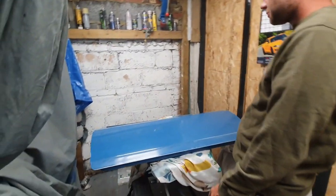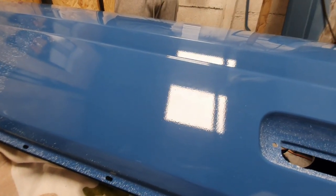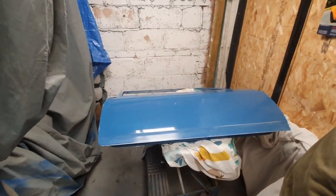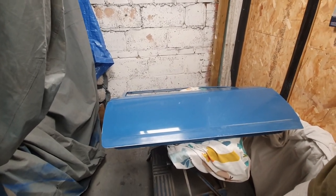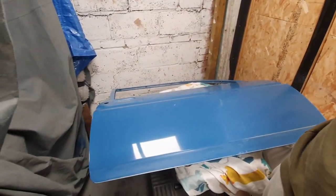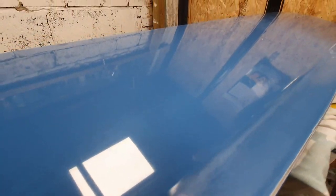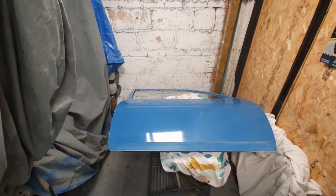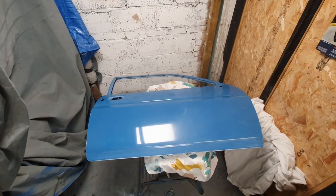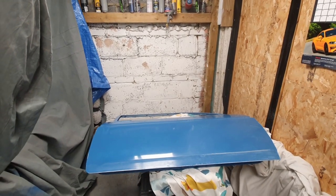So the door that got painted — the paint experiment. There was a healthy amount of orange peel to start with but that's to be expected. The next stage is sanding to flatten it. As a painter, what was discovered is that we went for a sealer coat of thinned-down epoxy before the final coat of 2K solid paint. That sealer coat isn't flat enough — it's too bumpy and it comes through with the paint layers on top.